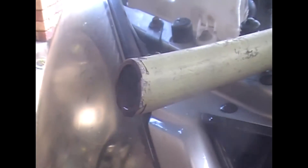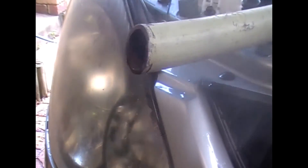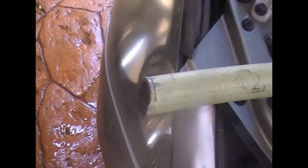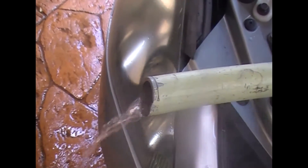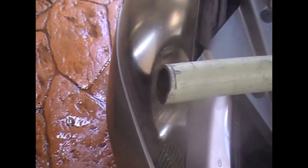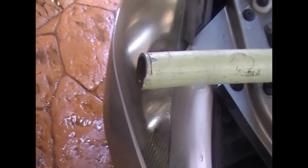I've got all the foam here that's cyphering through the water. When that foam builds up and gets caught in the motor, it doesn't show up when you're doing normal flushes. I've had this problem before — when foam builds up inside the engine, it stays in there. You've got to keep doing this, getting clean water through the system to get all that foam out. That's the drama you get from mixing coolants.